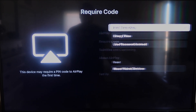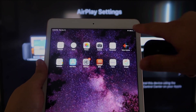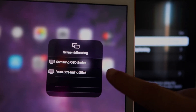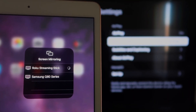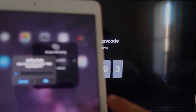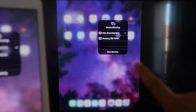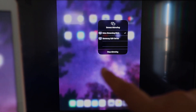Since I'm the only one using this TV, first time only is plenty for me. Now go over to your iPad — on the top right corner, swipe down and it brings up the menu. You'll see where it says screen mirroring; tap on that. Right away it shows available devices, including Roku Streaming Stick. Tap on that, it starts connecting, and it'll ask for the code shown on the TV — mine's 3393, yours will be different. Enter the code, click OK, and there's a check mark now — it is mirroring exactly what's on my iPad to my TV. To stop mirroring, select the stop mirroring button on your iPad.